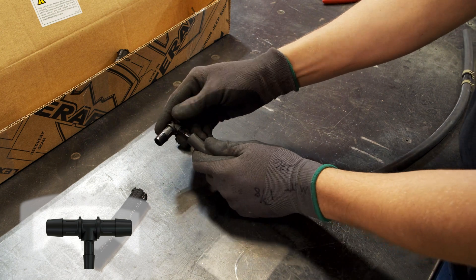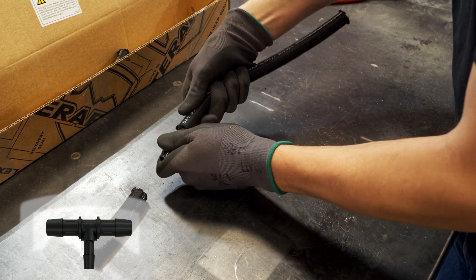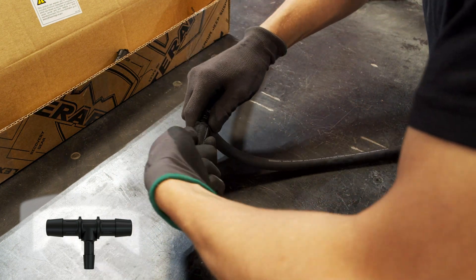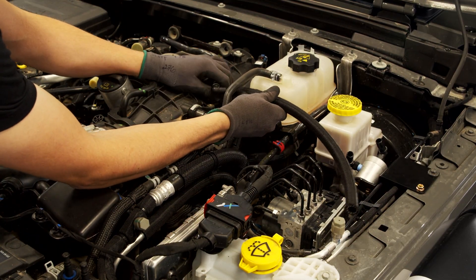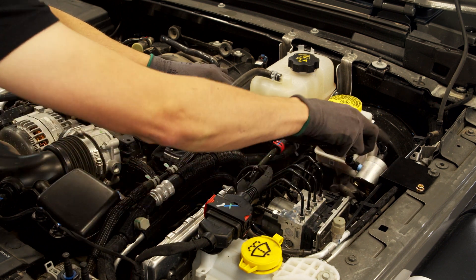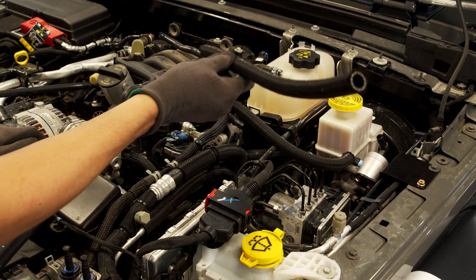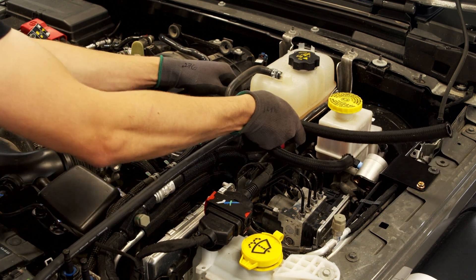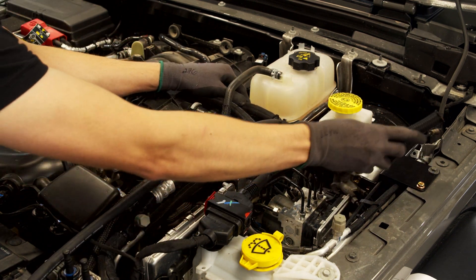Connect the long end of the 5/16-inch diameter hose onto the small barb of the T fitting. Connect the short and medium length half-inch diameter hoses to the fitting. Install the long half-inch diameter hose to the line that runs from the factory PCV valve. This will then connect to the fitting on the side of the ball check valve. Connect the short half-inch section of the hose assembly to the fitting that connects to the intake manifold. Connect the other end of this line to the upper fitting on the ball check valve.